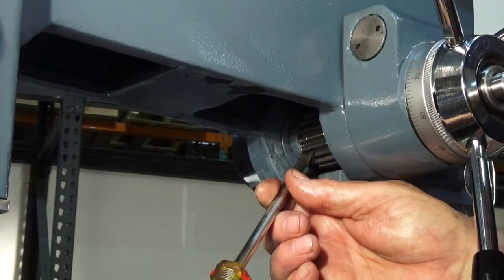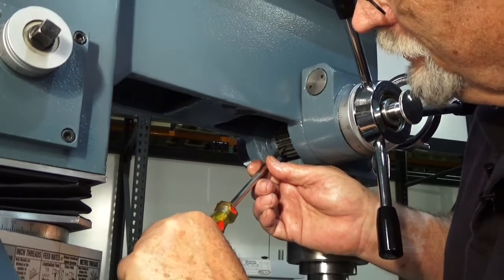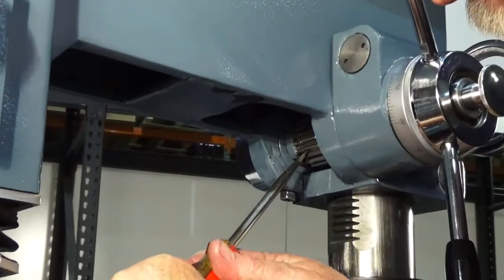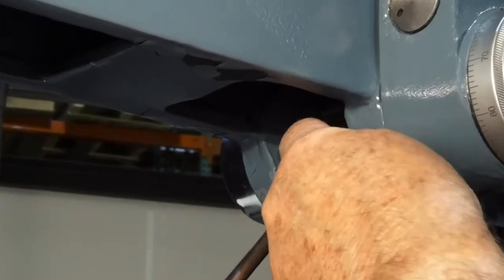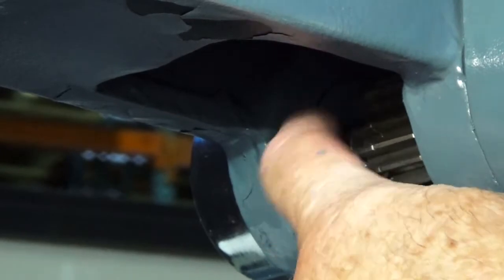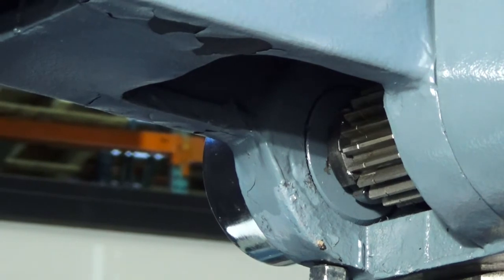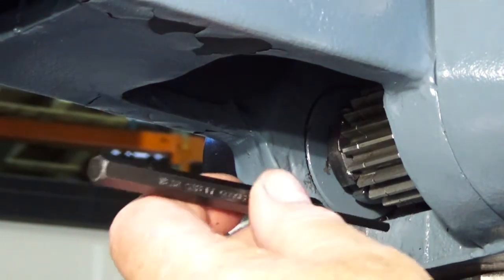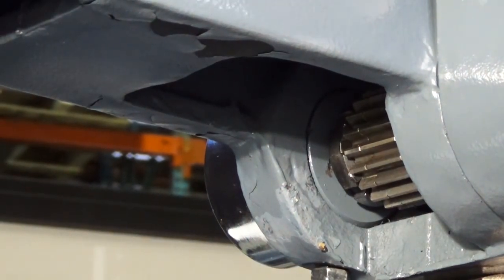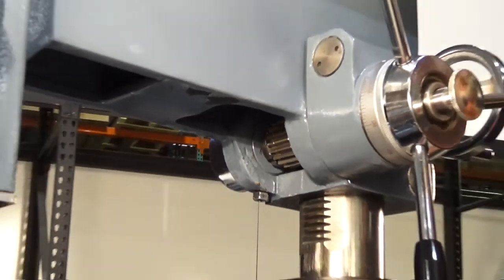Now I've got a screwdriver in here, right over the crack between the two gears. If I turn this screwdriver a little bit, you can see that one gear moved down. So now I want to hold that and tighten up my nut here on the end. Then we'll come in here with our hammer and punch and tap this nut the other direction to tighten it down. The tightening direction will also try to move that little gear in the proper direction to take up the slack.